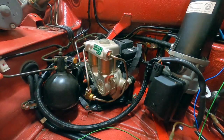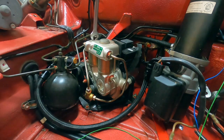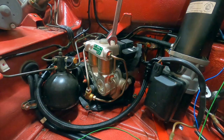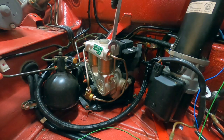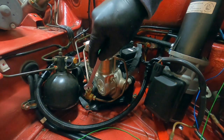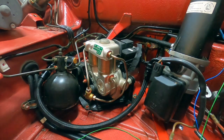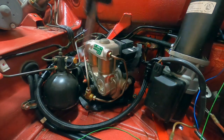Time for the ABS to make an exit. This is a three-channel ABS — you can see it has a connection labeled R for right, L for links (left) — those are the two front wheels. Then it has H for Hintern (rear). The two rear wheels are connected because this is a three-channel setup, so whatever the left wheel does, the right wheel does as well in the back. Normally in this setup you'll also see a reducing valve on the rear wheels — I've taken that out on my car to increase the brake force on the rear wheels, which works great. The other two connections go to the master cylinder in a two-circuit setup.